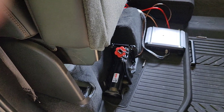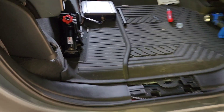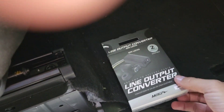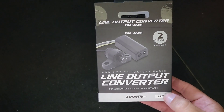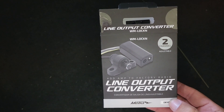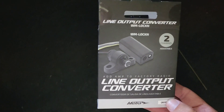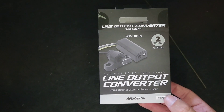You can pull this carpet up and run your wiring around back just to kind of hide it a little bit. I haven't got everything completely touched up and cleaned up but it still turned out pretty clean. I used this line output converter because I have the Bose system — I bought this one at Walmart for about 21 bucks. It gives you the ability to control the bass without having to go with an LC2i or anything like that, saving you about a hundred bucks.